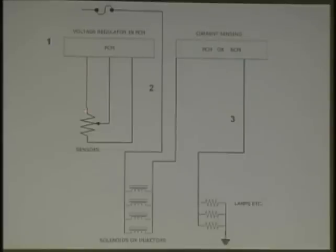You've got your voltage coming out, goes through the resistor on the sensor, out the other side, back to ground, and it's got the sensor lead, what they call the wiper on the sensor, which picks up basically just a static voltage reading as it moves across the resistor. That's like your TPS that you would get the reading out of. A lot of times out there, sometimes cars won't start.